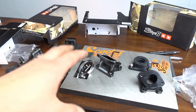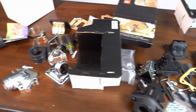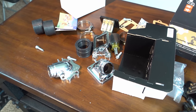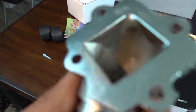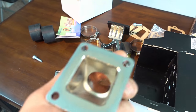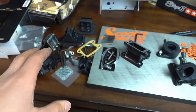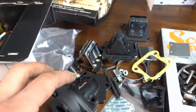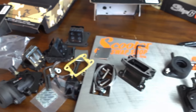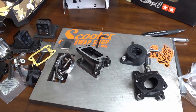Unbolt it — this guy's ready to go, take it out of the box, pop it on and go. I would still use Honda Bond on all these mating surfaces. If you guys are interested in the Goofit manifolds and you're the type of person that really likes air leaks and chunks of Chinese plating falling off in your engine, that's a really good fit for you. If you like to blow up cylinders and have air leaks, this is what I'd recommend. If you want something good right out of the box, get yourself a good brand-name manifold — not a Goofit. I've probably sold a thousand of these Stage Six and quality manifolds combined and don't have any issues with them.